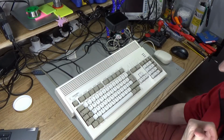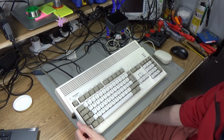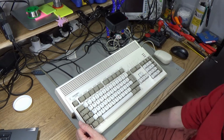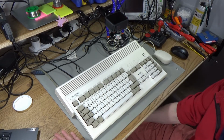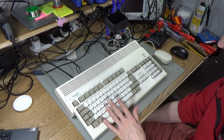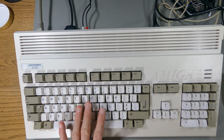And for the record, I have the evidence now that you can Retrobrite with an aquarium heater. It will take a long time. If you're willing to wait, it'll probably work. But even in the end, even I just couldn't wait any longer for it to get rid of that last bit of yellow. But yeah, these look amazing.